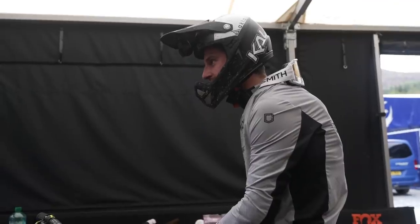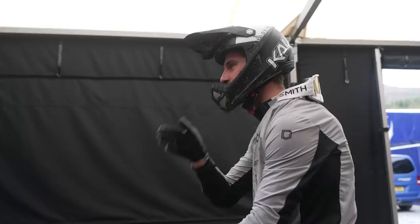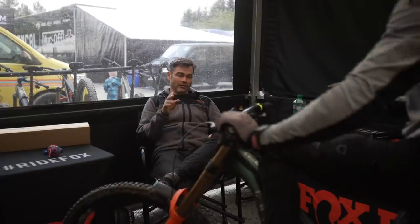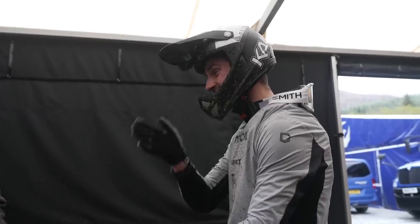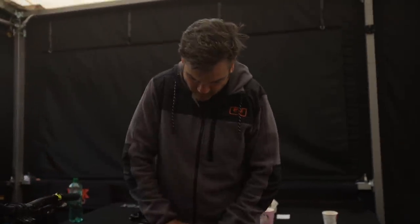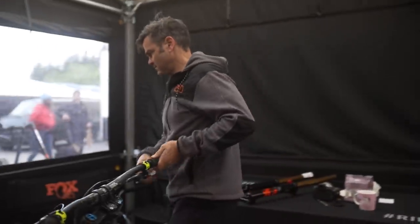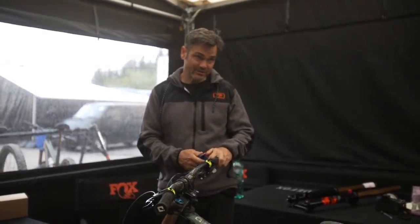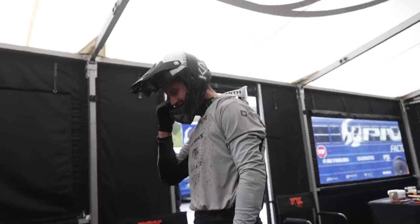Kind of got to pick which you'd rather manage. Could I do something to make it hang a little less coming in? There are a few long corners coming in where the holes are pretty deep, and it feels like the front end just hangs — like it hits the hole and comes out of it too quick. You're running super high pressure right now? Like 272, 275 yeah. It's a little quick.